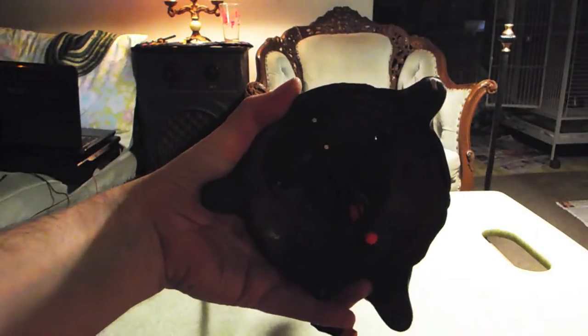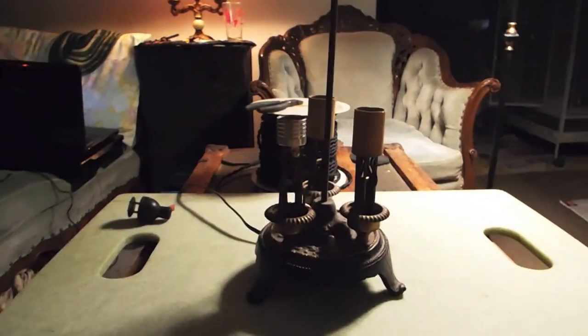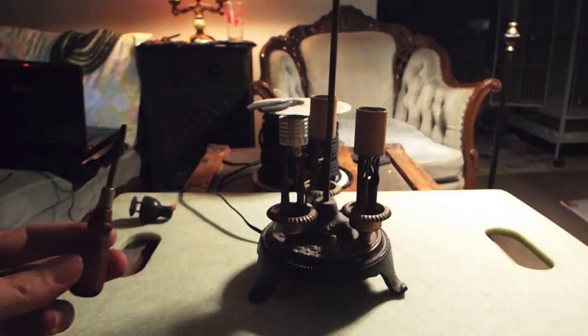What you'll also want to do is look under the base to see how it's wired. You'll see one wire from the cord goes to the switch, one wire from the cord goes into one lamp, out of that lamp two wires come out and go to the next lamp, and then two wires come out of that one and go back into the cord. So it's fairly easy to wire. You'll also need a screwdriver for undoing the terminals on the lamps and for undoing the plug.